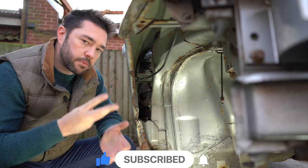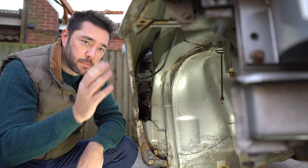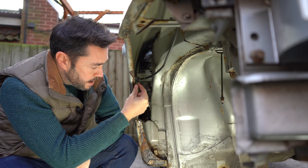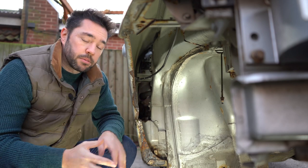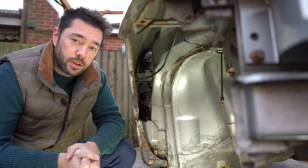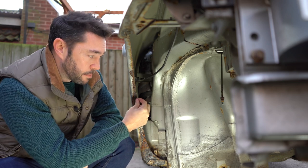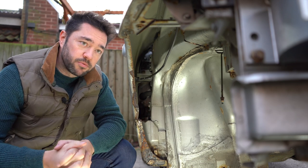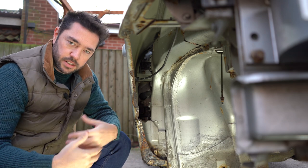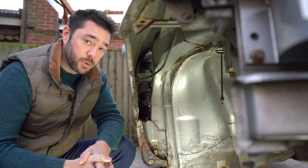I think I'm going to go with option three. I'm going to take the wing off, take it back to bare metal, see how much of this lip is remaining and if it's good. Then I'm going to do what one of you suggested - it was actually a Canadian viewer, so thank you very much for the suggestion - and go with a fiberglass option. Hopefully there's enough of this lip left to wrap some fiberglass around, then filler it, paint it, spray it. Wish me luck.